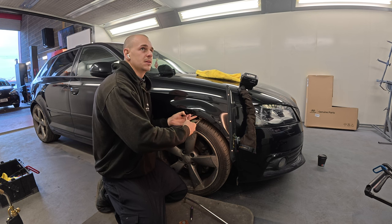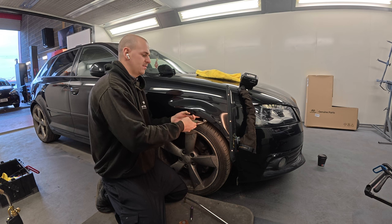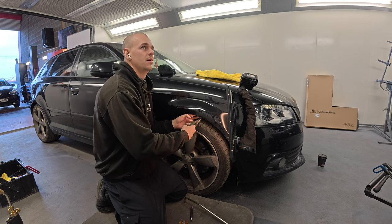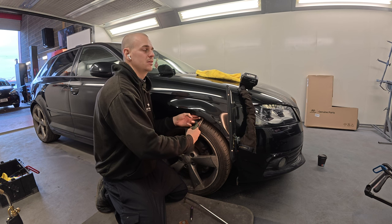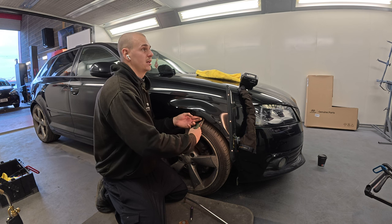When you put the cams in, there's like a, I'll show you, I've never seen it work. It's got like a little thing you have to line up. And I'm guessing he hasn't done that because he says he's going to check it. So it could be that, but it says cam crank correlation code or something. Trying to change the sensors, to swap the sensors over from the other bank to the side and stuff like that. But can't seem to get it clean.